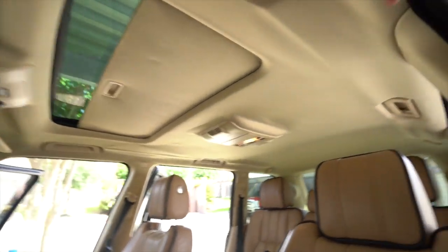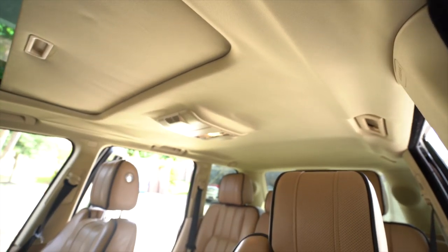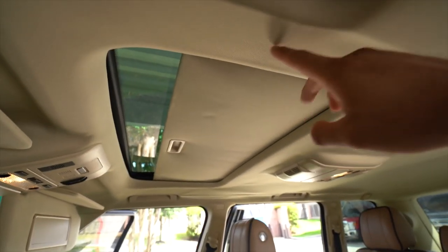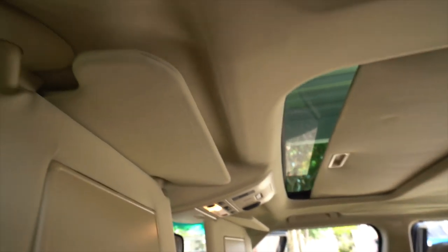Again, if this is your first time cleaning a headliner, you may want to give it some time to dry, so you can ensure that you've actually removed the stains and they're not going to come back or form more rings based on your cleaning. But remember, with those rings, if they do form after your cleaning, just wipe it down with APC. Literally just spray into the towel or into the stain, the ring, and wipe it down. But yeah, pretty simple.